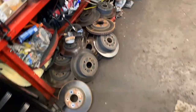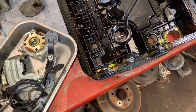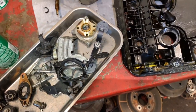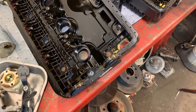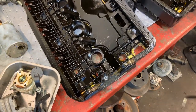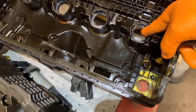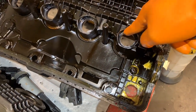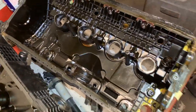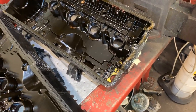What you got to do is kind of like put it against the edge, wedge it inside, and then spin it while pushing pressure to push the tubes in, while you're trying to lift the back cover with a screwdriver or your hand. It worked out good. Yes, you will make some marks in here, but that's not a problem — the important part of the seal is the cylinder, not the edge at the bottom. I may even recommend replacing the back covers as one piece, but we'll see.